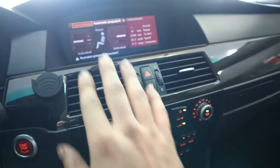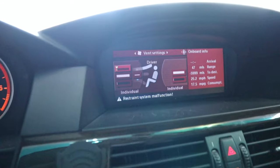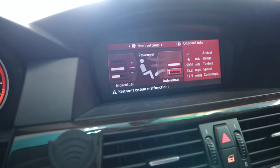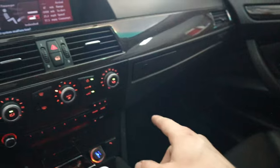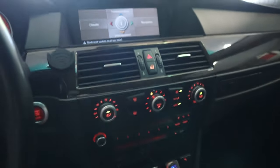I had the vents closed before because it was annoying with that hot air coming through, but now hot air is going to come through on purpose. We're also going to open up the vents for the feet, because before I had hot feet and cold air coming out here, which was very annoying. Hopefully changing this valve solves that — we'll let the car get up to temp and I'll update you once we've got some hot air coming out.